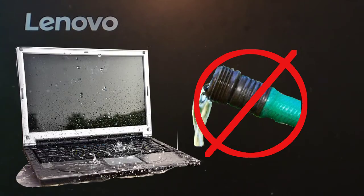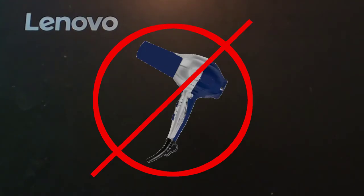I'm also going to show you how I got information out of this laptop while the keyboard wasn't working. This was sprayed by a garden hose and I gave it a week to dry out. I had fans on it, used the rice method, had a can of compressed air — tried everything, nothing dried it out. I also found out that using a hairdryer is not the way to go; it could cause static electricity. For those of you that work on electronics, you already know this. For newbies like myself, it was an experience.